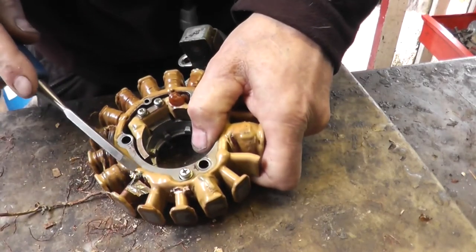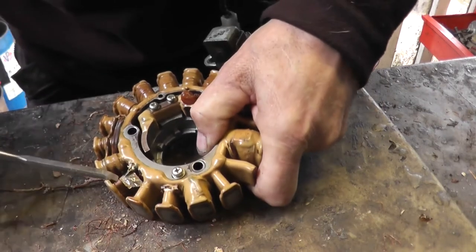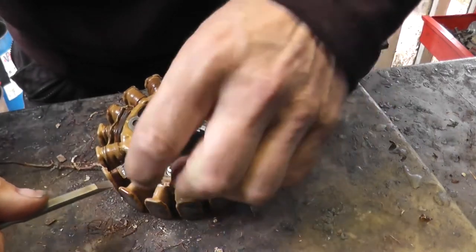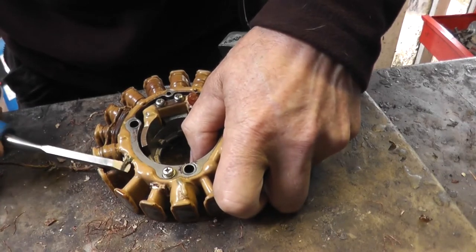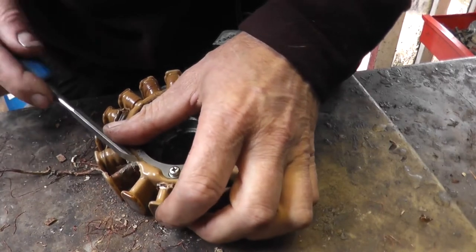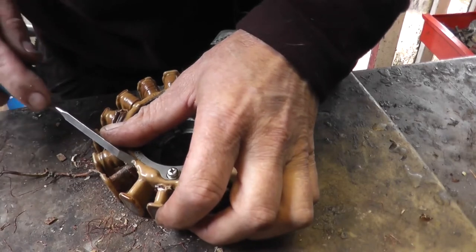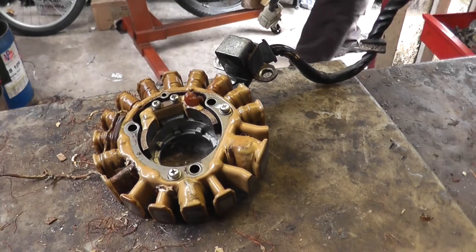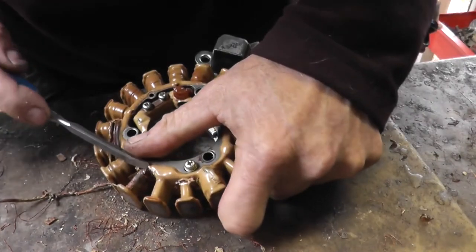Anyway, that's where your white wire comes in — you can just see it there. It goes underneath, goes up that bit. That's where you start your winding. Cut it over a bit of tape — there you go. That's the cable insulation, rotten. So I'm guessing it's just probably shorted out just about down here. Yeah, just clean that up. So that's the high speed source coil unwound. I need to obviously clean it all up, make it look nice. Re-insulate it. That one's ready for doing.